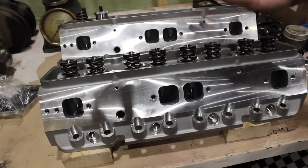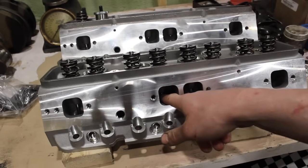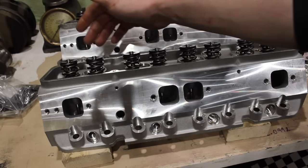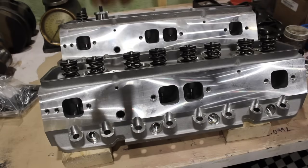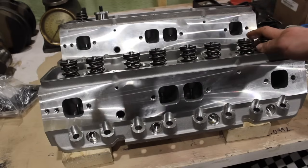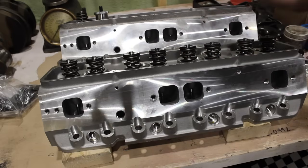So I ordered the set of heads and things are a little different. They run 8mm valve stems, which is pretty cool. It comes with ARP studs and plates, AFR plates, adjustable guide plates. So it's a fully assembled head — other than putting the guide plates in and normal stuff. It comes with a dual spring for hydraulic roller. Nice set of heads.